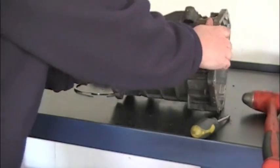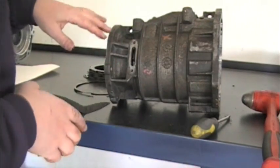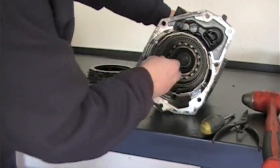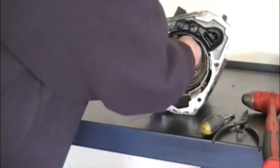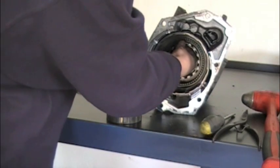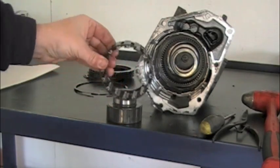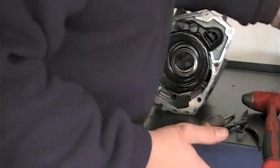I've already taken the liberty of removing the top inspection plate, which had two T25 Torx bolts. Sometimes you can use needle nose or regular pliers — we're going to expand this using a special snap ring plier. I don't want my overdrive sprag to come apart, so I'm going to try to extract it first. I could just release it all and let it fall out, but then the rollers are going to end up on the bench in pieces, and this is not a very inexpensive sprag, so I want to reuse this.